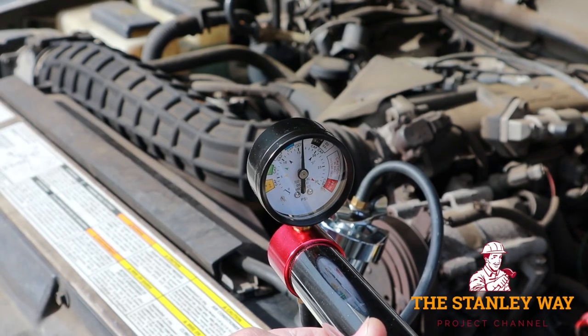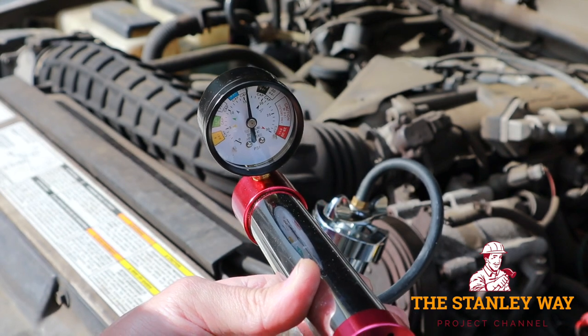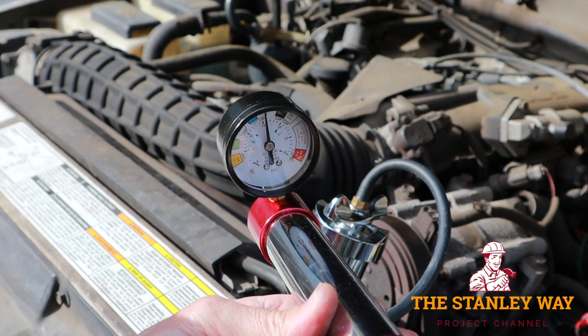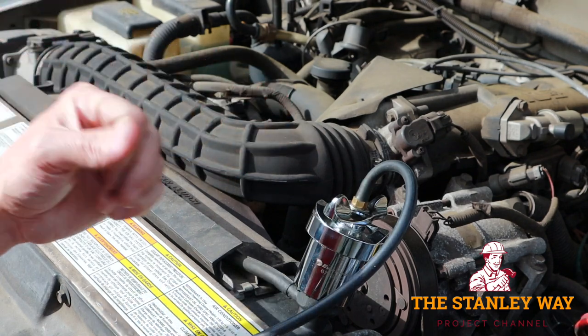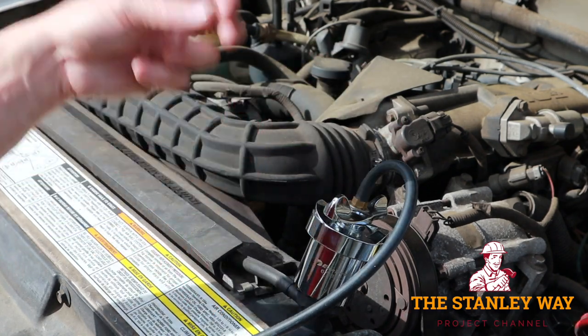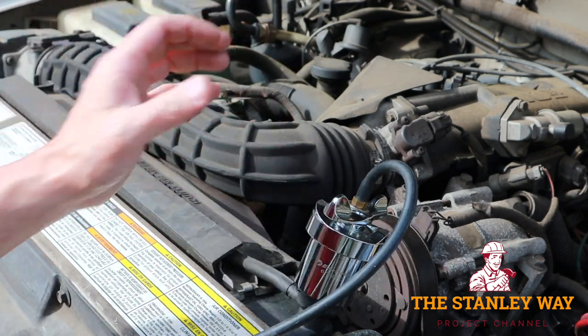After about 10 to 15 minutes, look back at it — we barely have any drop in pressure. This engine is cold, so it could be that whatever is leaking opens up whenever it gets hot. What you can do is leave it running, take the radiator cap, back off very carefully and very slowly. You can even put gloves on and put a rag or big towel over top of it so if something blows out it's not going to blow in your face. Take it off, then turn the engine off — you can pressure test with it hot.